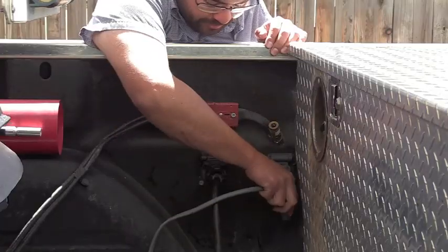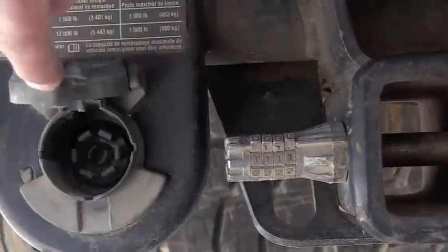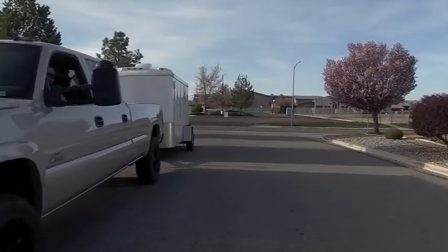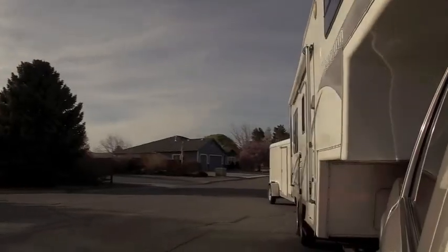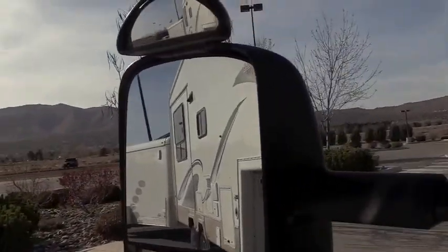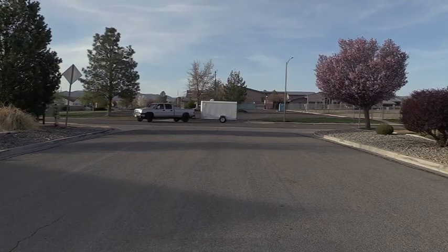The rearmost trailer is wired into the bed of the truck and also to the rear electric plug on the back of the truck. So I can hook up the second trailer directly to our truck and drive around to set the brakes the way I want them. Setting the trailer brakes on the second trailer is very difficult from a distance — they can be too tight or too loose. By hooking it to the back of the truck and using the same brake controller, I can get them very close to where I want those brakes adjusted.